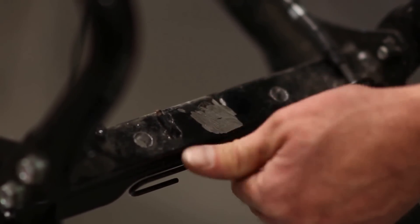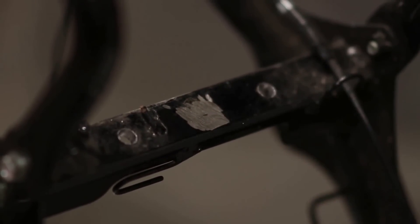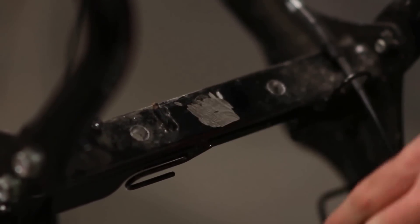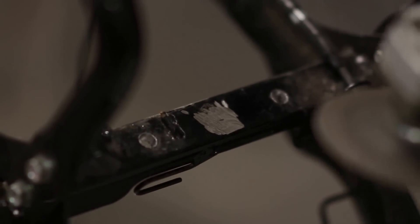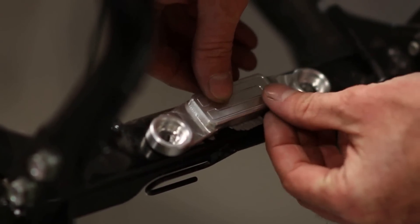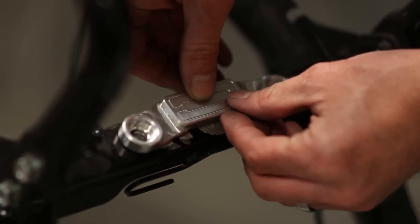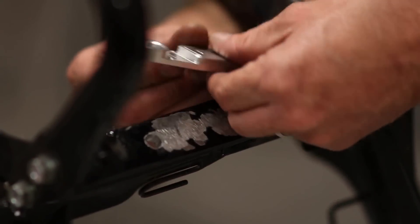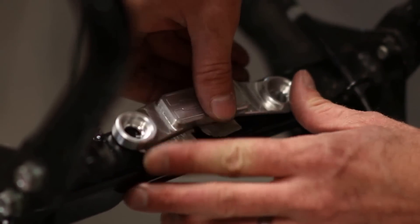As you can see it's nice and smooth. We're going to repaint it, and this bracket is going to cover most of it, but there'll still be a little bit visible so we're going to make sure we paint that. If you want to make it look great, you're going to use sandpaper — 60 grit all the way down to 2000 grit — paint it, wet sand, and buff it. But since this is going to be mostly covered, I'll orient the plate so when you open it you'll see the Composmo logo, and I'm going to paint it mainly so it doesn't rust.